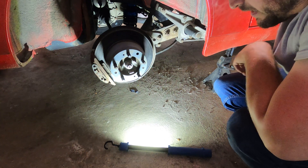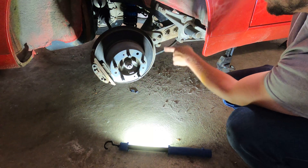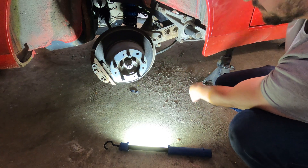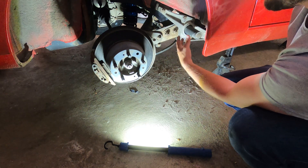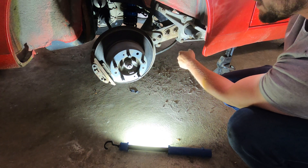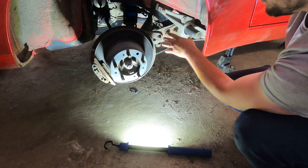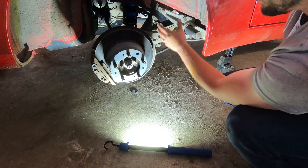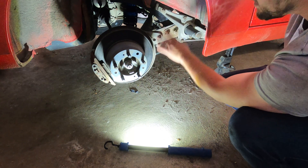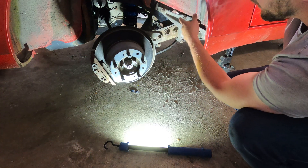What a pain, what a nightmare. The special tools you really need are the M8 triple square, the 27mm wrench, and the 36mm for getting all the bolts out of the spring plate and control arm. That's the right way to do it. Basically what you want to do is disconnect the brakes, disconnect the sensors, unbolt everything, and just drop it. It's easier that way and you're going to save time. Just make sure you hang the stuff that can't fall, like the axle and the trailing arm.